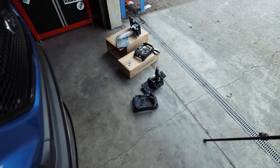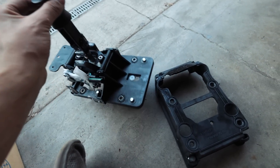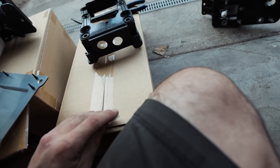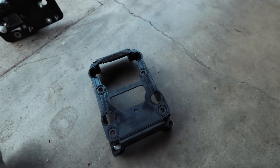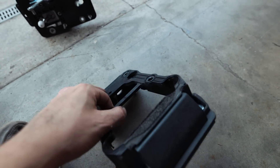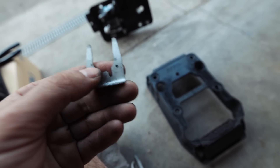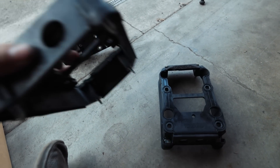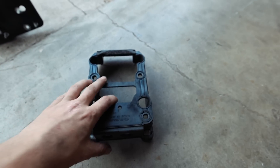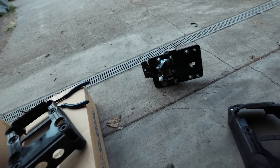I've got the STI one here and the WRX one here. This assembly comes out relatively easy - it's all bolt-in. There are two clips on the bottom: one literally just pushes off, the other just pulls off. The hard part was these two little clips. I had to unbolt this piece from the chassis, drop it down below the driveshaft, then use a really long flat head through the gap to get down where the cables sit and beat them out with a hammer. One notable difference: on the STI unit the cable holes are offset with the left side much higher, while on the WRX unit they're right next to each other.